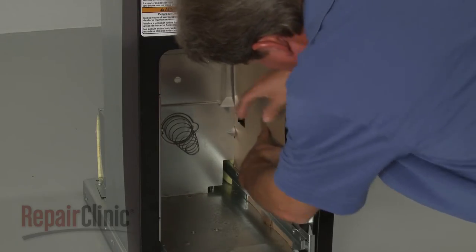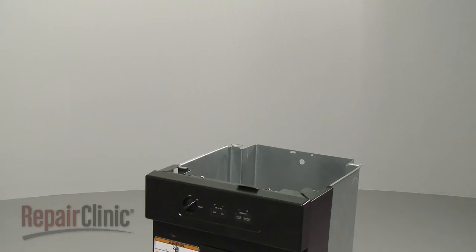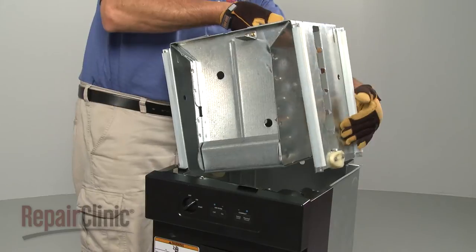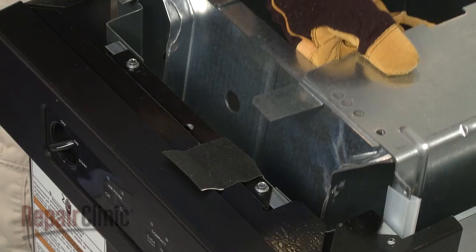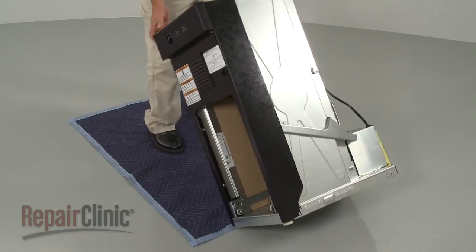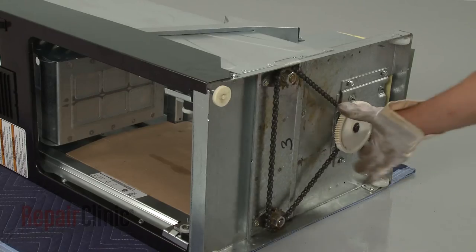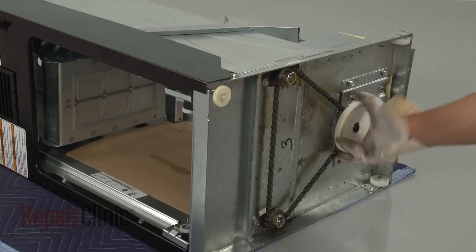Replace the shield. Carefully reposition the ram, making sure the stop bracket is in the front. Set the compactor back on its side. Rotate the large drive gear clockwise to re-engage the ram with the power screws.